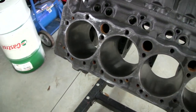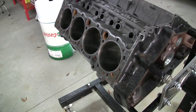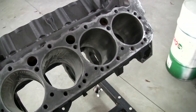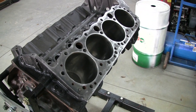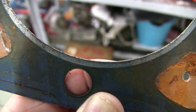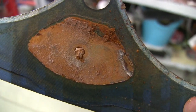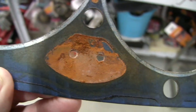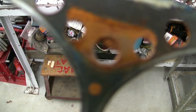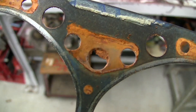I ran a mill bastard file over the block - I don't know if you can see this or not, but it doesn't look very good to me. I don't have a good precision straight edge, but I'm going to drop it off with the machine shop and let them take a look at it. We may have to deck the block - it looked like the head gaskets were leaking on it before I tore it down. We'll see what Mike and buddy have to say. Look here at the head gasket - some of these holes are completely stopped up.